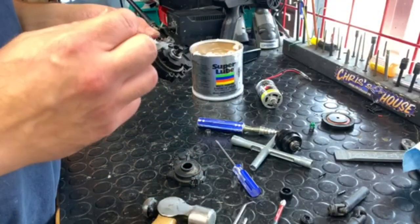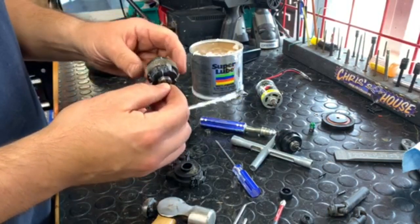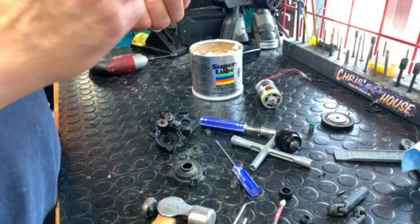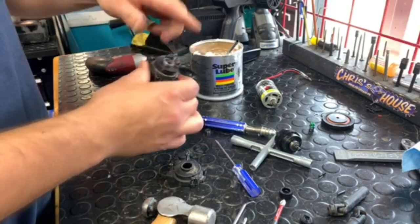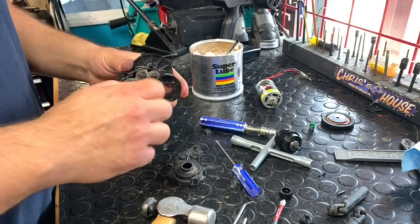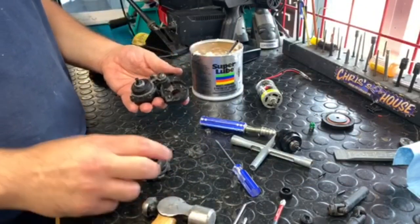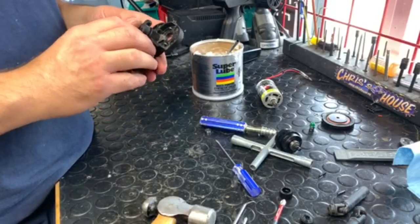And then what I'm going to do is sneak some grease in there. I'm actually just going to pop this out real quick, and I'm just going to get it right on the teeth. And we don't need to go crazy. I see some of these, I'm like, holy cow, the thing is so packed. I'm like, sure, whatever. But so let's just rotate it. Goody, goody, goody, okay? There's a bit of an argument out there that says straight cut gears don't need grease. Well, good for you. You know, that's the argument on my end.